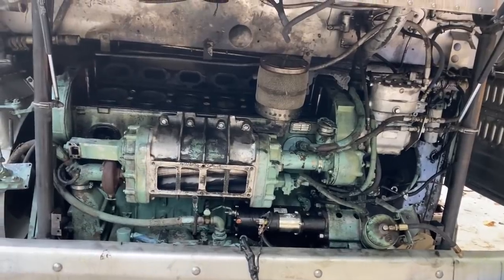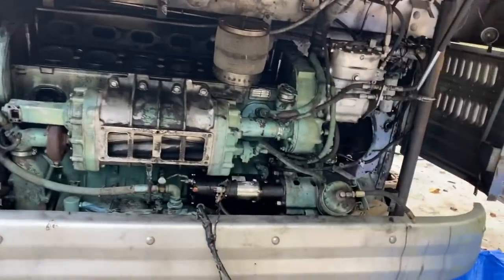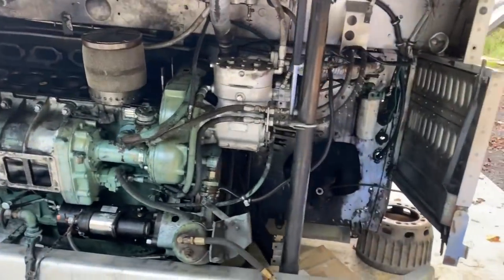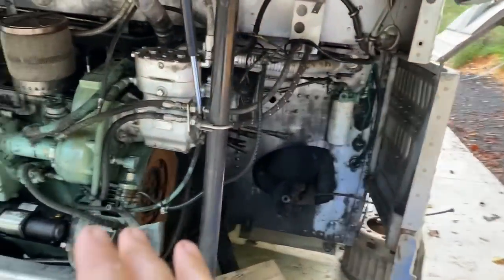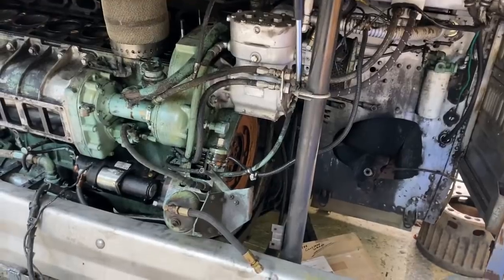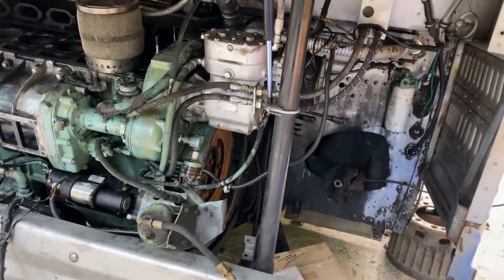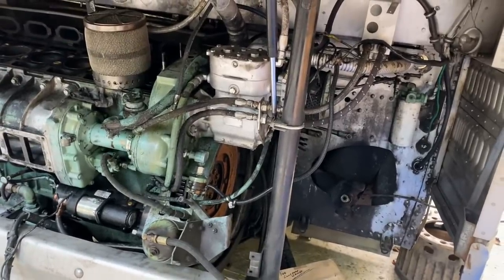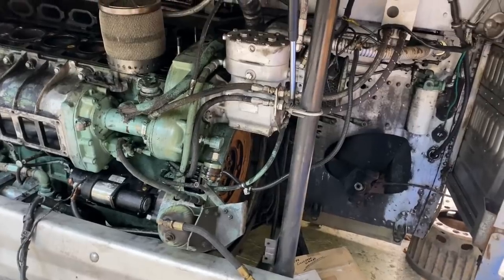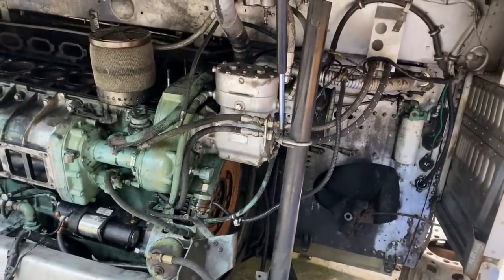I thought it was only down one cylinder, but I thought that was going to be the only problem with it. Real quick, you know, simple in frame, no big deal. Well, once we got it here, we knew it had a loose flywheel. That was another noted problem. So the first thing I attacked was the flywheel, because if the crankshaft was damaged from the flywheel, that was going to completely change the way we were going to have to do this rebuild. So I pulled the transmission, the flywheel, and the crankshaft. I had to clean up the mating surfaces on it. The crankshaft was not damaged. I was able to reattach it. It didn't wobble. It was nice.